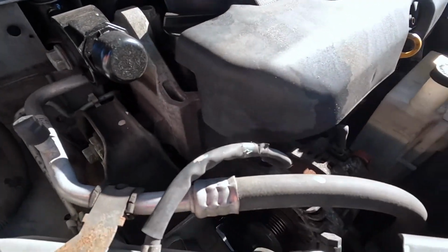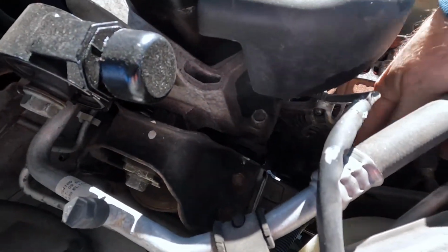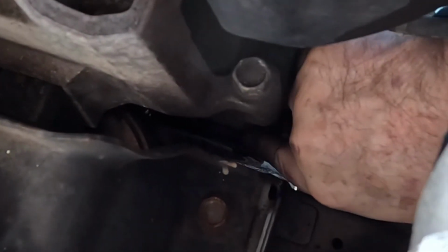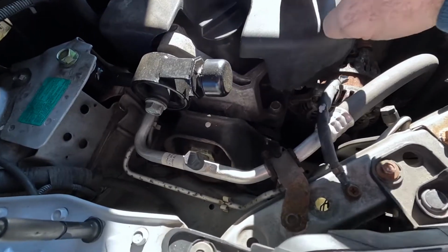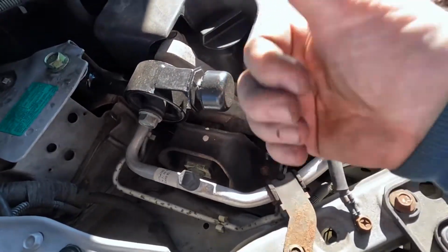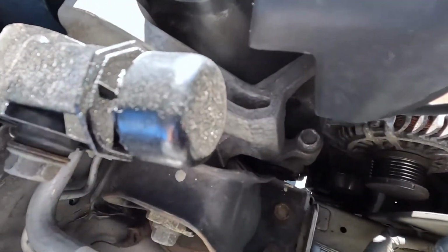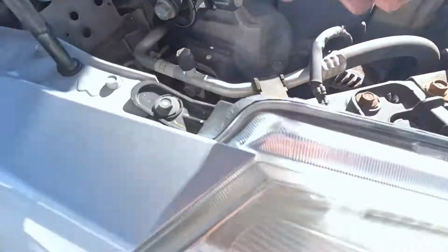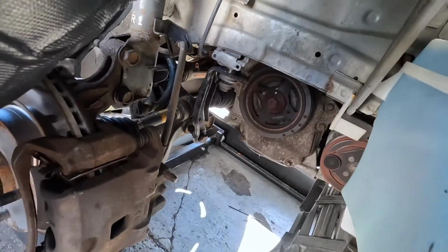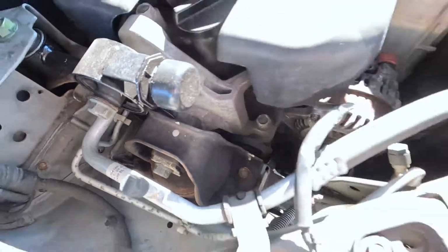That's one of the things we deal with on some of these cars, and you look at the procedures for this. It says remove bolt and remove tensioner. That's the bolt down there for the tensioner, and it's pointed at the frame, and it's an Allen. So I'm guessing you take the engine cover decoration off, take this whole mount assembly out, lift it out of the way so you can jack the motor up and get the bolt to clear the frame. But it may not. There's a hole in the frame, I see there. There's a hole down there, so maybe you can get at it through here. I don't know. Pays a little over an hour. Well, let's see what happens.